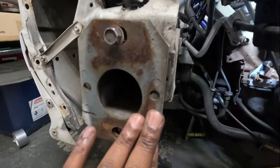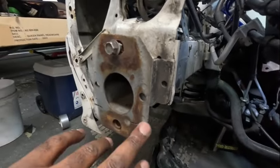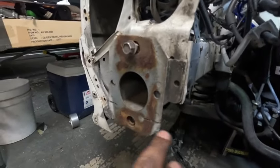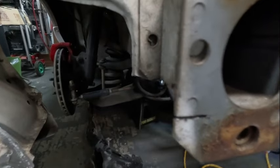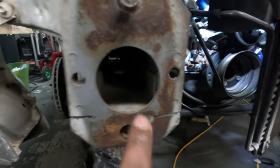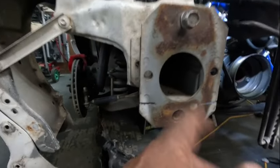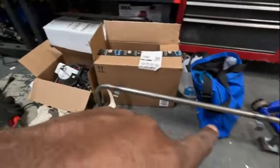Food for thought: pay attention to where your blade is, not just the portion you're actually cutting with. I put the guide right here and was paying attention to the back while trying to roll around this piece so I wouldn't cut it. In the process of cutting, I stopped paying attention and started cutting into it - did the same thing on the other side. I'll probably shoot some weld on that to strengthen it up and then grind it back down smooth.